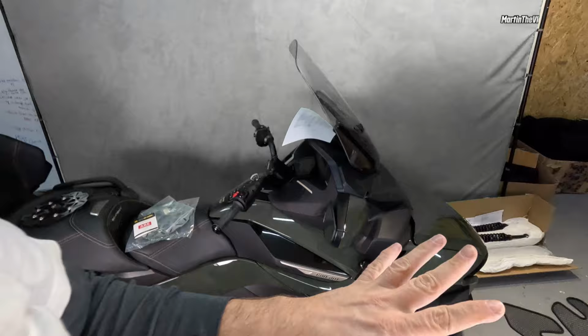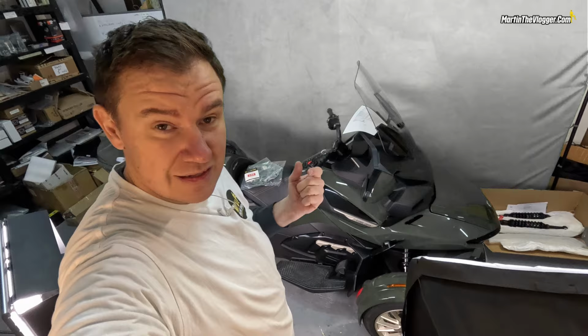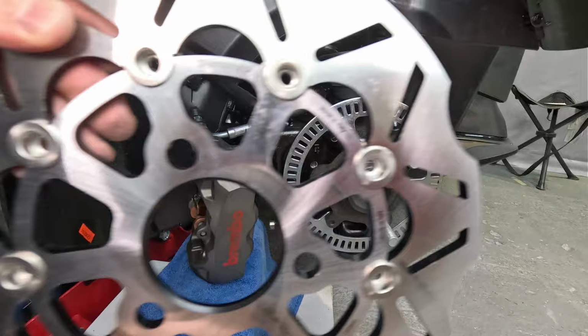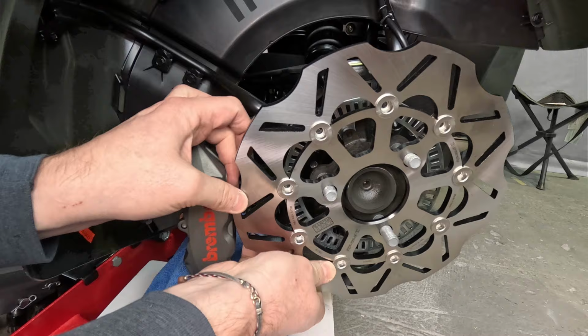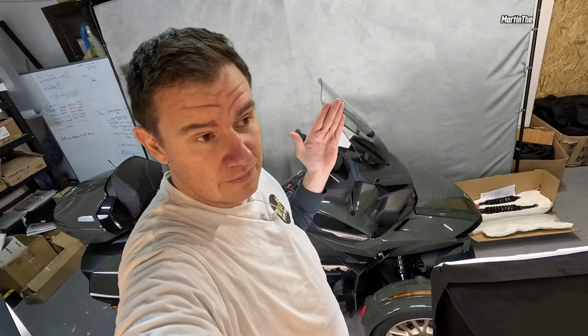The problem is, I don't even call it a bike, I call it a boat, because it's big. It's like a Goldwing on three wheels. It's 500 kilos plus you, and it has the same brakes as on the F3, which is a much smaller, much lighter bike. This customer told me he will be riding aggressively. But riding aggressively or not, it will cause the rotors to twist.